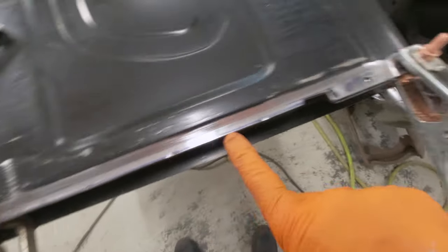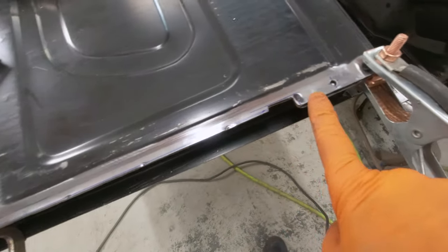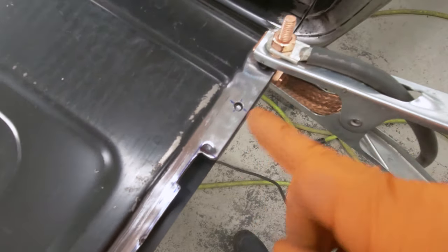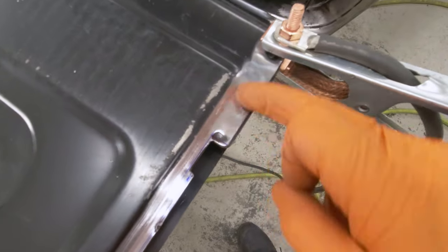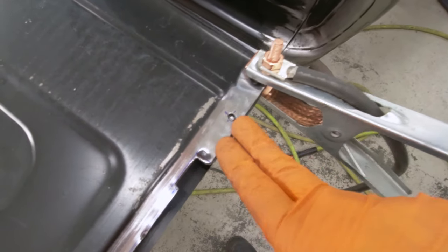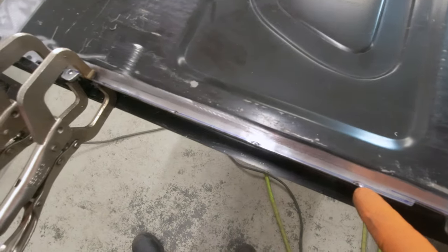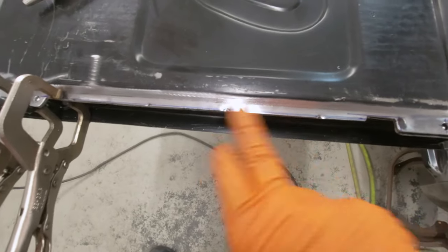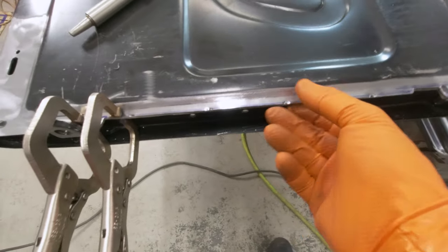With that, since this area has been cut out, I'm going to add some additional spot welds on here to reinforce this structure on the side of this thing. You can also see here, there's this little bit of black overlap — these are where these two panels come together and this is the kind of stuff that's just normal. You're going to see this on factory builds, but I'm going to shave this black piece back to meet up with the already cleaned off section so it's just a cleaner look. When the gate falls down, you don't see some lip hanging past here.